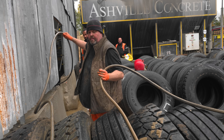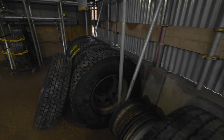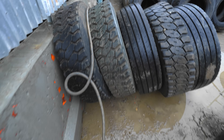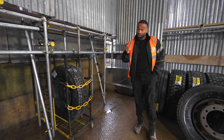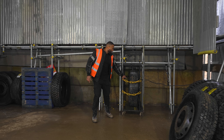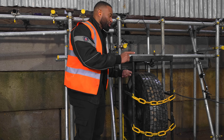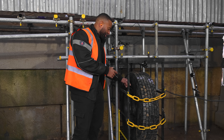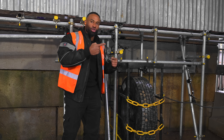Here's the setup to keep everyone safe. We have our inflation gauge outside, connected onto the tire, and we have run the hose out to the safe area. The compressor in the van will connect to the gauge, and we'll be able to monitor the pressure from outside. Our gauge only goes up to 175 PSI, but the compressor will keep going. The front of the cage is where we put the tire in. We expect the pressure to go sideways, not out the front. The most dangerous thing is the rim — if the rim goes flying. But the pressure should go sideways.